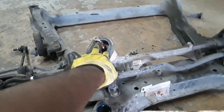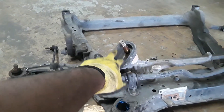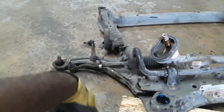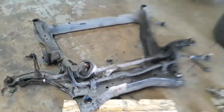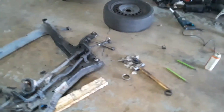Take off the rack coupler from the steering column, take off the lower ball joint from the spindle, take off the outer tie rod end, and also the stabilizer bar linkage, and the engine mount for the transmission. Then lower it down and press the new bushings in.